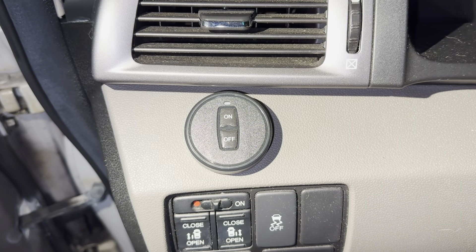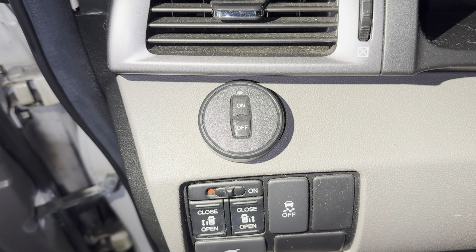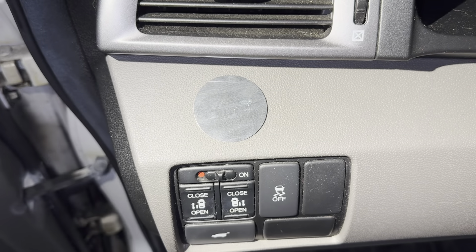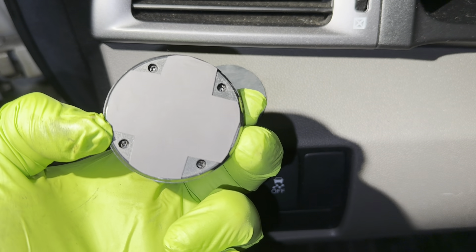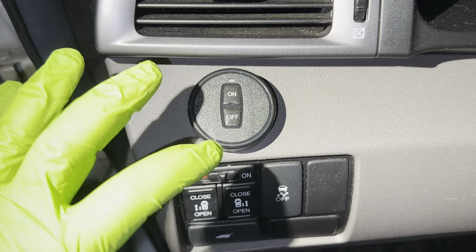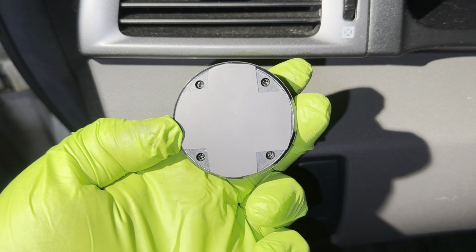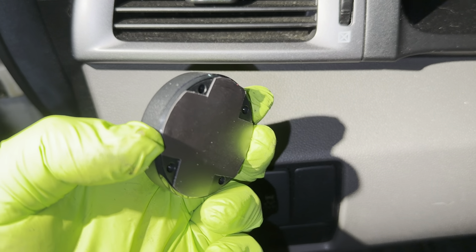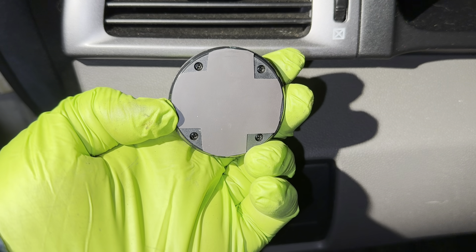Inside the car, I have it hooked up to a wireless switch, and it's pretty neat how it works. This is just on the dash — it's a magnet. The switch itself comes with a little plate that double-side tapes to the dash. It came with magnets; I put a little extra magnet on there just because of the curvature of the dash. I took some flexible magnet and put it on the back. You want to keep those screw holes exposed because there's a battery inside this unit, and if you ever need to change it you'll want to take those screws out.